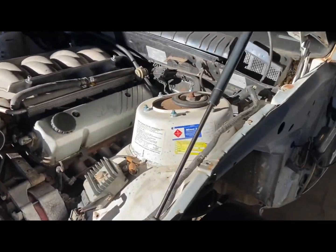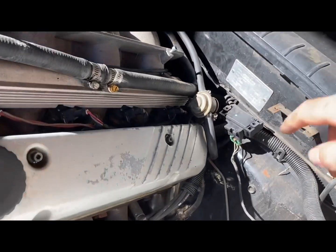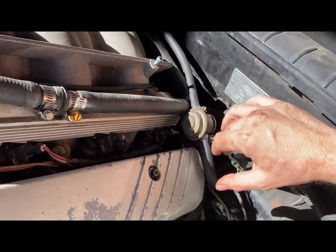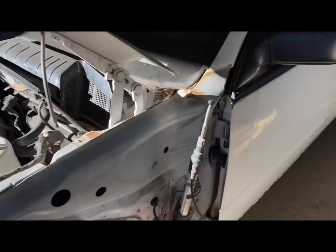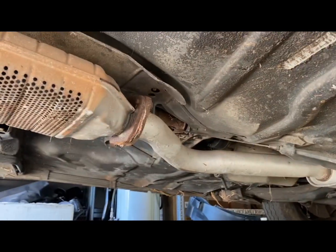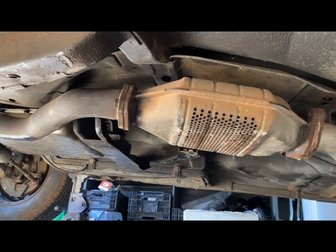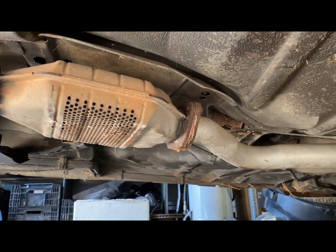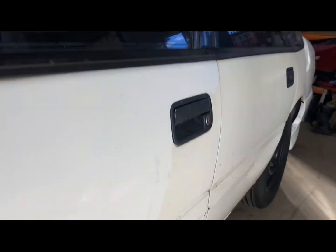A little bit on the struggle side with some power. Have a look inside here. So that was all twisted and bent, had some fuel coming out through there. We've gone underneath and replaced it. Let's get underneath the car. So we've actually put the exhaust back on it. It was in the boot of the car. We've done that so we can hear any rattles or something from the engine, just to quieten the car down so we can concentrate on what is coming from the engine bay.